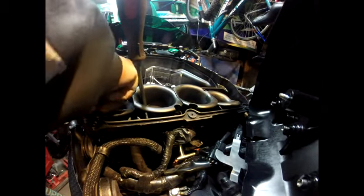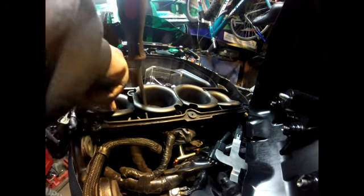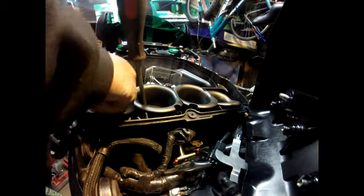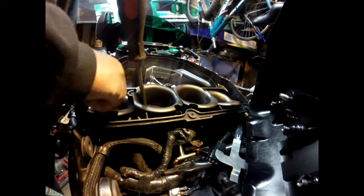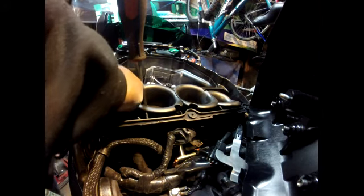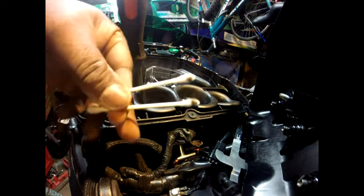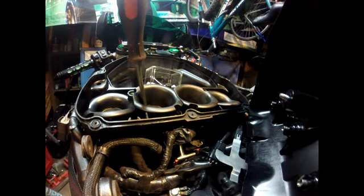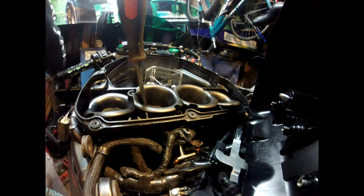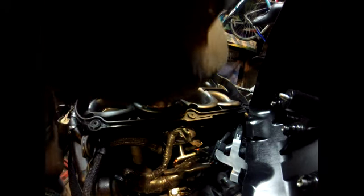This little dirt debris can cause your throttle to stick, or what may feel like your throttle to stick. The throttle body's here. That's the result. I'm just using some Q-tips, and I'll take some starter fluid, spray it on here, get it nice and wet, and clean it up.